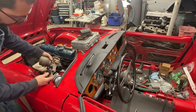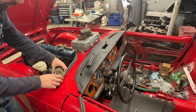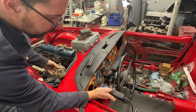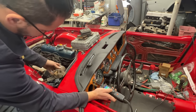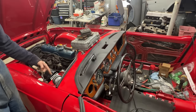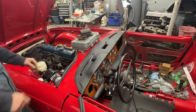If I unplug it and plug in this other motor I have here — it also came with John's parts — and put power to the blue one, it works. Put power to the red one, it works. So my wiring is okay. The problem is in the motor, and that's too bad because this was the motor John cleaned perfectly — I just painted it and installed it, but it didn't occur to me to test it. So I have to take it out again.